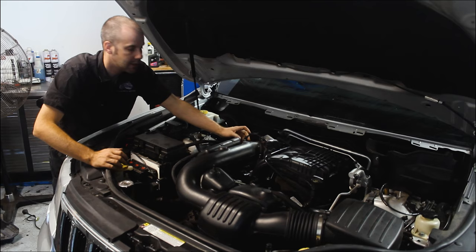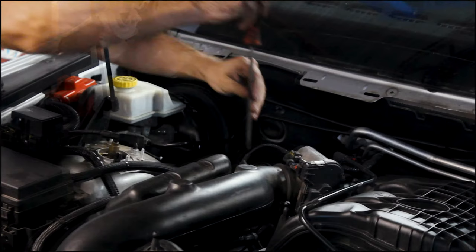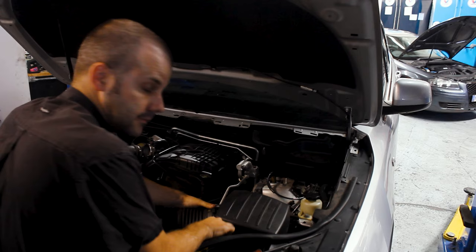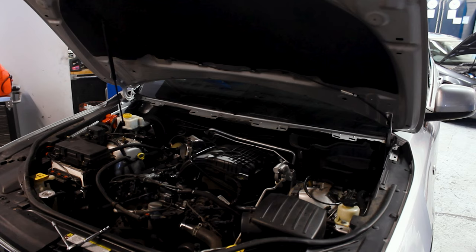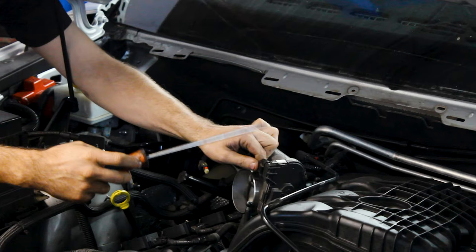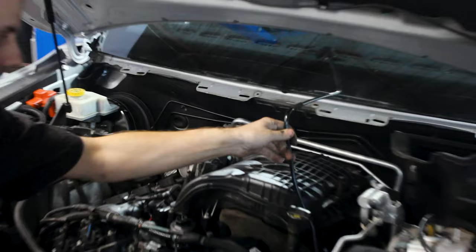The first thing you've got to do is remove the air intake — just undo the air box, the hose clamp at the throttle body, and the sensor at the back. There's your throttle sensor — it needs to be unplugged. You've already undone that from the ambient air temp, and your MAP sensor just behind it. You just flick these little red tabs back, then push them in and up they come. Take this vacuum hose off the top and just swing that out of the way.